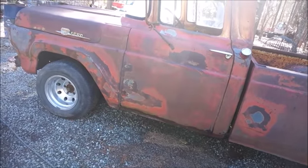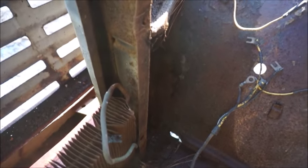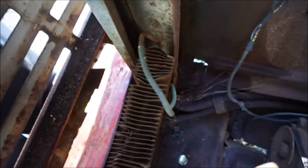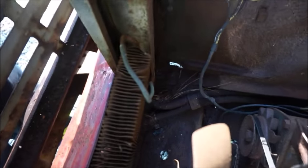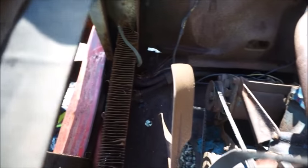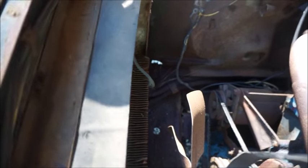I'm going to go ahead and change out that transmission cooler, and I'll show you the reason. It's actually got an air conditioning condenser in there being used as a transmission cooler. But these lines look like they're quarter-inch lines going into a three-quarter line. I just can't imagine that flows right — it's got to be restricting it. Any time you get restrictions on the hydraulic system, which is all a transmission is, you start building heat, and we don't want that. So I'm going to change that out.